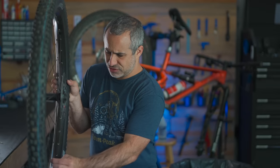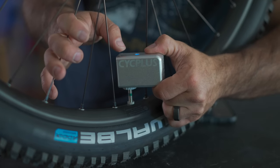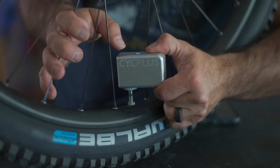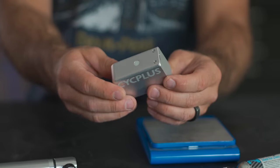So this is definitely better than a hand pump, but how much can you get out of it before it runs out of battery? Let's inflate it up again and see if we can get two inflates out of this on one charge. It sounds like it's struggling — we're at like 17 psi. We barely got two inflates out of it. Now for a road bike this would be fantastic because you'd pump up the tire in no time, and could probably do it over and over. Road bike tires are really low volume. But on a mountain bike tire, you're barely getting an advantage over a CO2. In fact, the CO2 is a lot quicker, smaller, and lighter.